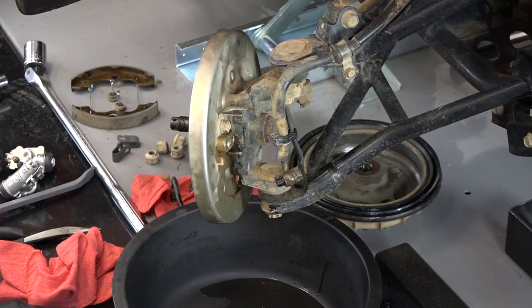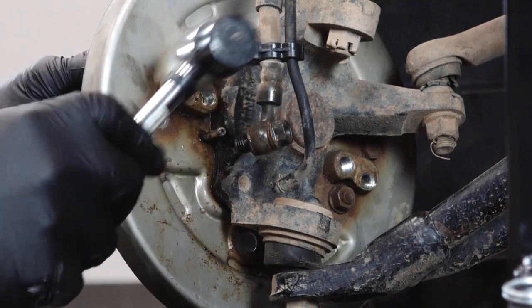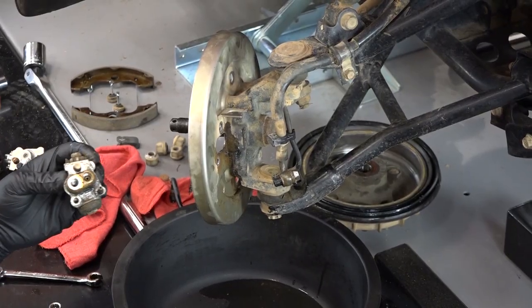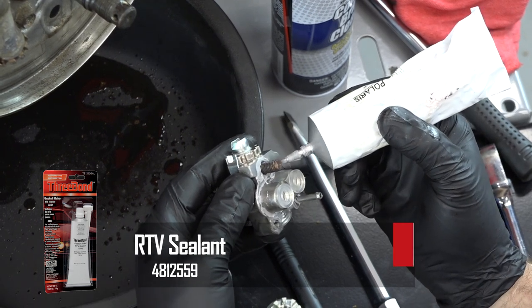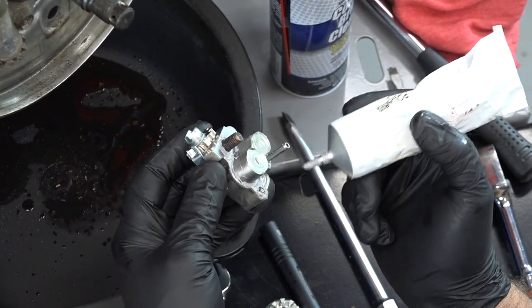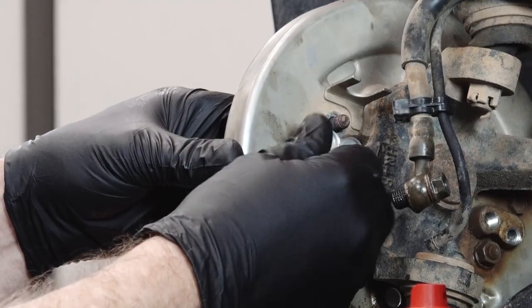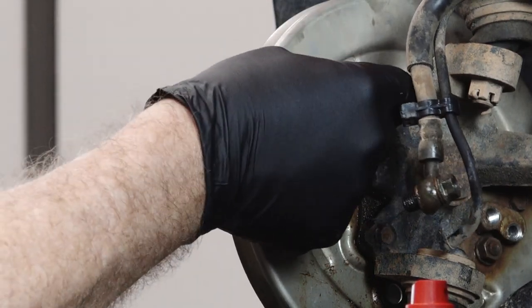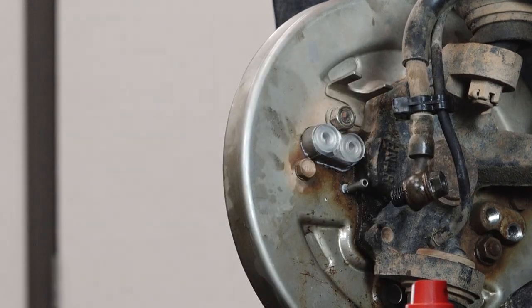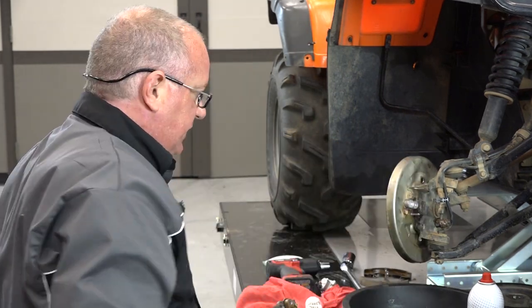Now we can go ahead and break that other one loose. Alright, we've got our crossover pipe out. Now we can unbolt them from that back plate. Give her a little tap and out she goes. Now we can grab our new one. You need to apply sealant — RTV, I'm using crankcase sealant — all the way around this area, all the way around these two points, around that vent and around that bolt. Once you've got that done, pop it back in. Replace that 10mm down at the bottom and get that 12mm on back up top. Note that I installed this with the plug still in — I recommend doing that because you don't want to get any dirt into the system, as it would wreak havoc on it. Now we just need to do the same thing on the back side.